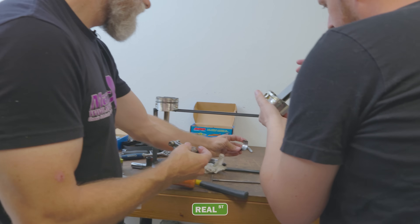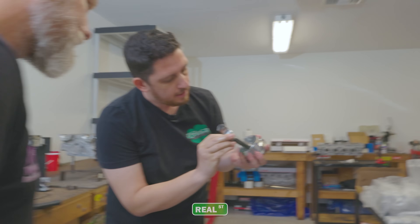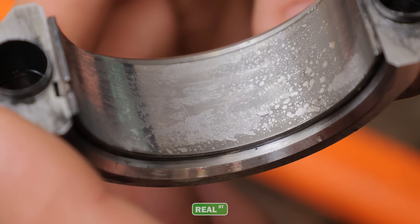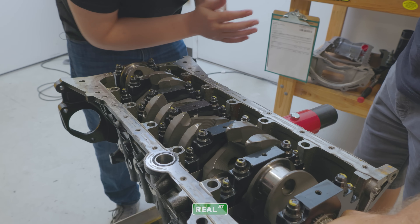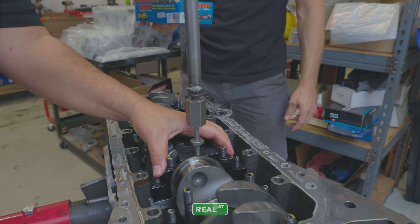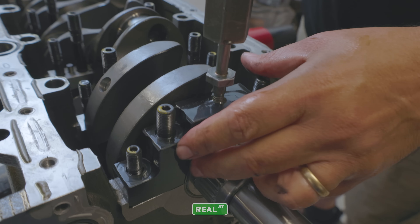The piston is definitely fine. That one's probably the most suspect bearing there. It's an interesting witness — it's not debris, it's not witnessing grooves, it's just almost patterning. I was able to speak with Dan Begley at Clevite and he said the bearings appear to have suffered overlay fatigue, likely due to a compromised oil film, which makes a lot of sense given our use of the OEM wet sump oiling system. He also noted the wear on the lower bearings — two of the common culprits being high piston speed and heavier rotating assembly weight. Given that we were using a steel rod and a heavy pin and a heavy piston on a compromised oil film, all at high engine speed, this falls in line with what we expected.